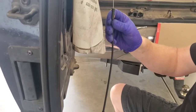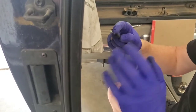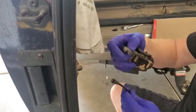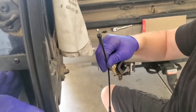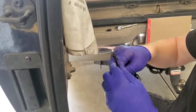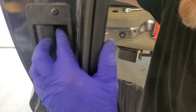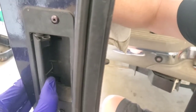Now we're going to take the cable and install it first into the actual door lever itself — way easier to do it that way than to install it on the latch first and then drop it in. I would not recommend that because the tension gets pulled on the cable and you only get a small amount to work with to hook it up to the door lever. So I would highly recommend to put the cable in first, pop it in, slide it through, put it back the same way you took it out — push straight up and it's locked in place.